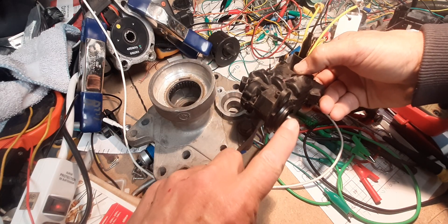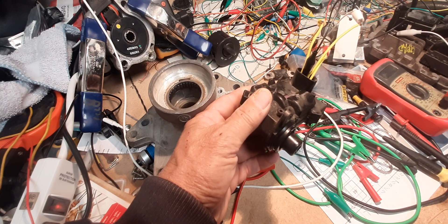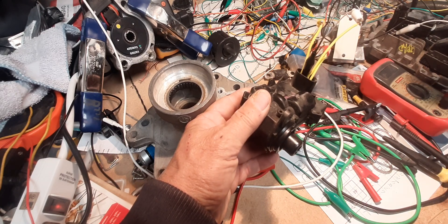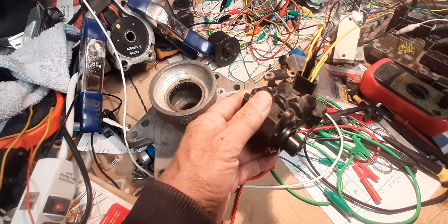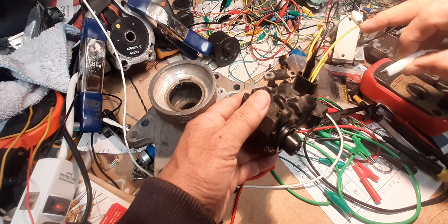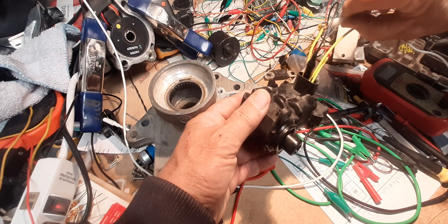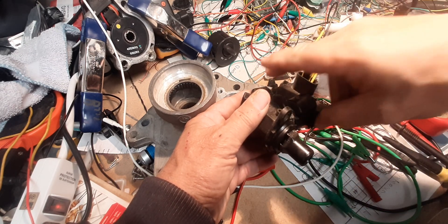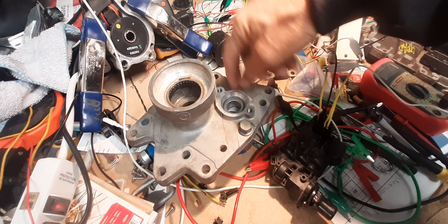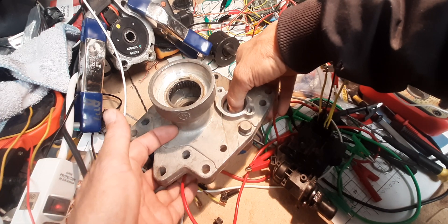Once removed, you can see here's a plunger. I've got this all wired up here and I'm just going to jumper it so it activates. When you switch to any four-wheel drive mode, this actuator is going to engage and it's going to extend this plunger. The plunger extends in order to push down in this hole, which will move a shift fork, coupling two different gears in here.